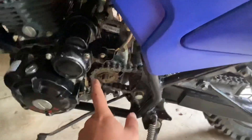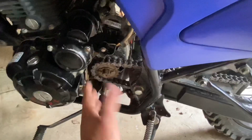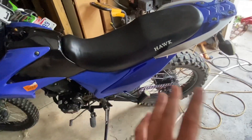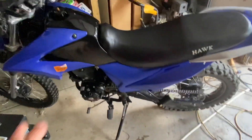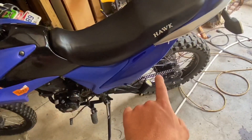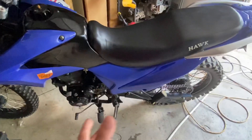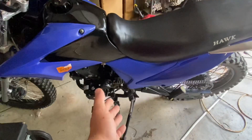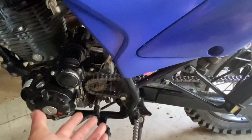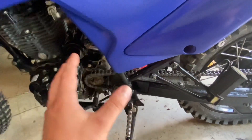One other thing I want to mention about the 16 tooth — why it is a huge upgrade over the 15 tooth — and that is because it doesn't skip nearly as much. If you guys have been watching my videos, you all know that the chain skips really bad, and it doesn't matter how tight you have it on the bike. On the 15 tooth front sprocket it just likes to skip. When I first put this setup on — brand new rear sprocket, brand new chain, brand new 15 tooth front sprocket — it was skipping like you wouldn't believe. If you have a 15 tooth sprocket on the front, it's going to skip. I put the 16 tooth on there and it skips a whole lot less. Plus the 16 tooth is a good combination for off-road and on-road gearing.